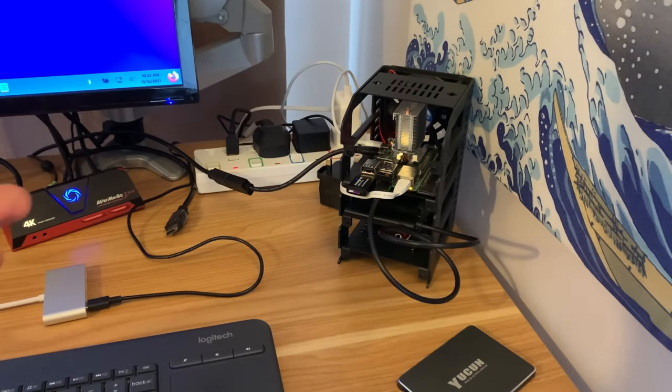which is just odd because the Samsung bar I found is a very compatible USB stick. And on the Pi 4, it runs loads of things and generally beats SD cards by quite a margin. And I've got separate speed tests on that if you want to check them out. But really, the winner here has got to be the Yucun. That is, if I go to this one, so the Yucun was 37,005 compared to, well, the bar was 25,000. The SD card was only 17,000.